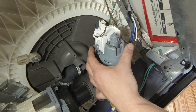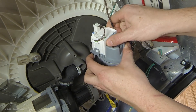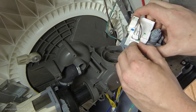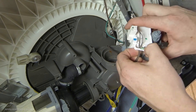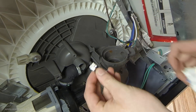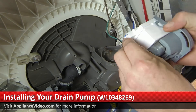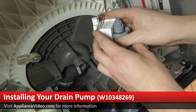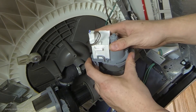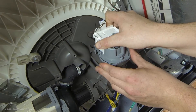First you're going to locate the clip here on the back. You push that down and turn this way. That will release the pump and then you remove it. Also here you just pull the wires out of the clip. Press the lock and remove. Take your new drain pump. Lock in your power wire. Make sure it's seated flat. Turn until you hear it lock.